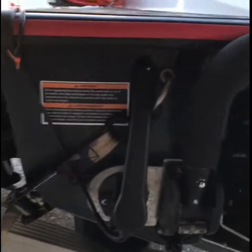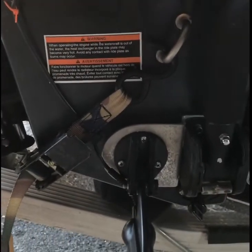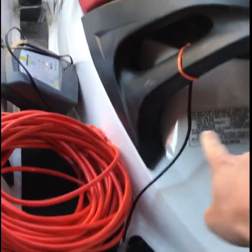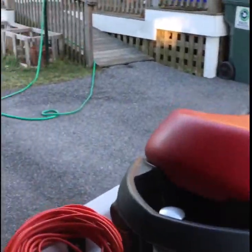I have a custom-shaped aluminum bracket so the transducer goes underneath the step — I didn't have to drill extra holes. It just folds down into place and folds right back up. The wire runs through here, siliconed in, and goes into the ski. The Wake Edition comes with these handles as well.